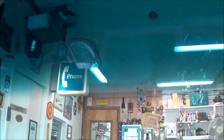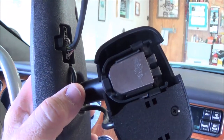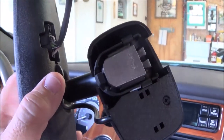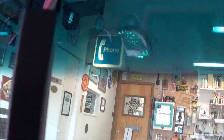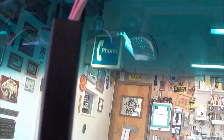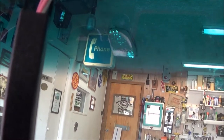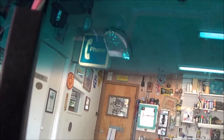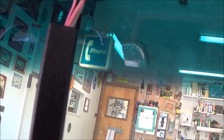The first thing you want to do is know where this little metal piece goes, because that's the part that's actually going to adhere to the windshield, and you want to know its orientation. What I do is go on the outside of the glass — you can see it in this picture here — and I just take a Sharpie and draw the outline of where the glue was. You can almost always see where it was on the window, but I mark that on the outside of the windshield so I know where to glue that little metal piece back.